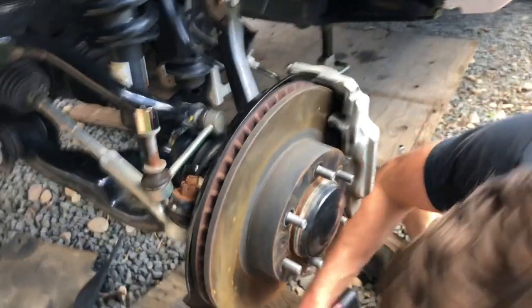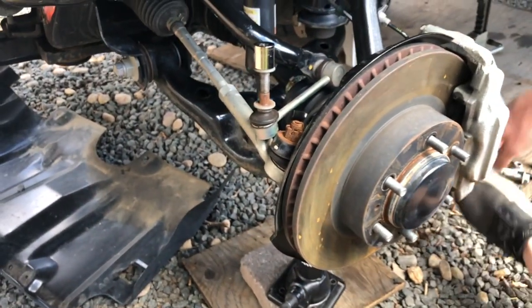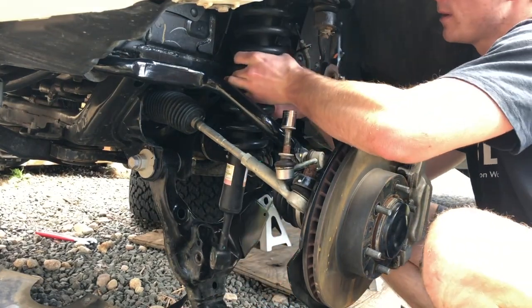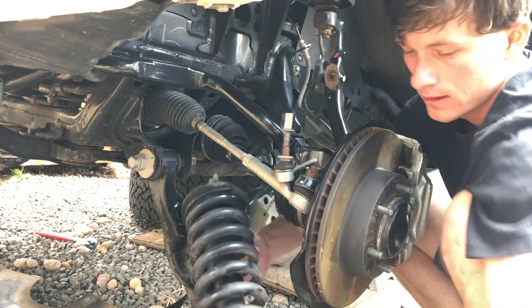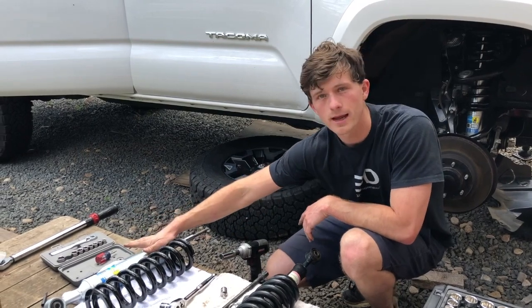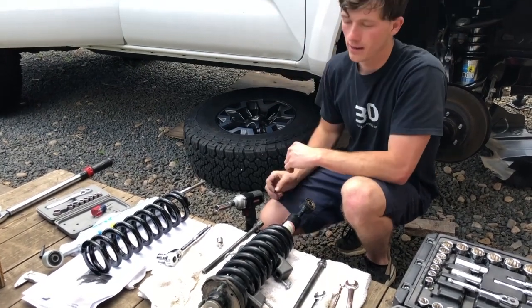There's one of them, and then the other one is up front. The lower control arm is completely free — I just need to remove the jack. Hold your shock mount and the lower control arm just drops, then you can pull your coilover out nice and easy — just wiggle it out. And boom, just like that you're ready to put your new coilover in. With the Bilstein 6112s you have a spring and a dampener, but it doesn't come with the cap on top — you have to use your OEM cap, which I really like because it has the original damping.